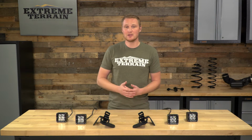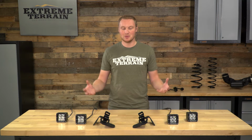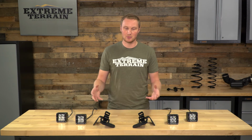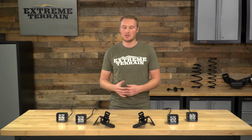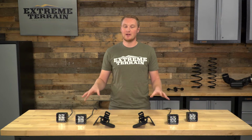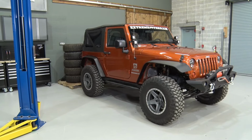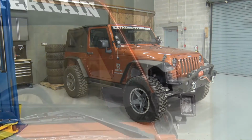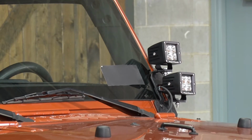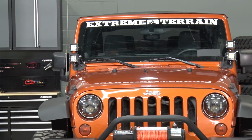Now, it's not the end of the world. Some of you it won't bother. Some of you might not have even noticed it if I didn't mention it. However, if you do a lot of research, most people that have been running lights in the A-pillar location for a long time will recommend a spot pattern, and I thought it was worth pointing out that these are a driving pattern. However, there are a lot of benefits to running 4 lights on your A-pillar. I personally like the fact that you could, if you decided to change some of these lights out, run 2 different beam patterns.